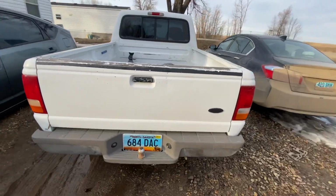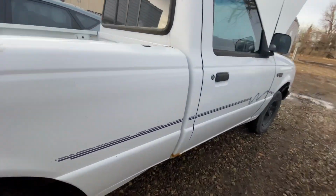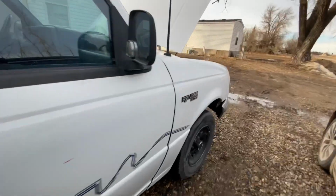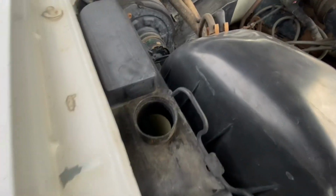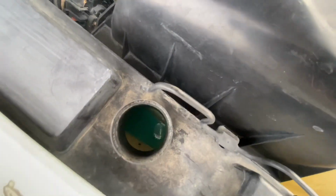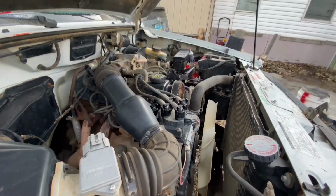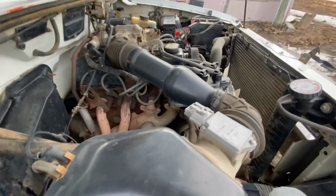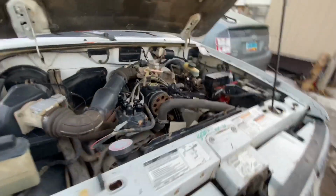I was able to narrow it down to the clutch slave cylinder. And lo and behold, for this particular vehicle, the clutch slave cylinder is internal. It's actually inside the transmission bell housing, which means that what you saw on the Mahindra Roxor at the beginning, held in place just by two bolts, if you have to do the same operation here, you have to drop the whole transmission.